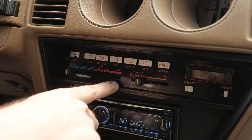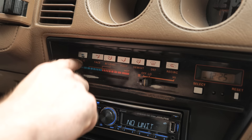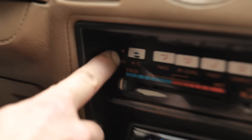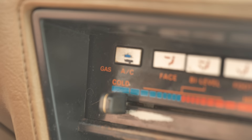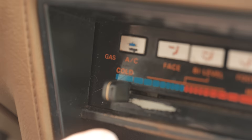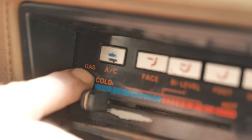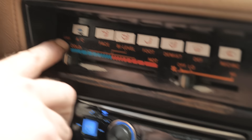My son's car — you'll hear an RPM change with the blower off, then blower on, it's anticipating a load for the AC compressor. Pretty crude system as far as that goes. AC button is right here. Did you see that gas light just come on? It says gas and there's a light that came on. If I shut the car off and restart it, the gas light is no longer on. So it's almost like the system, even in '86, is recognizing that it's low on charge. There'd be no other reason to have a light above an indicator that says 'gas' than the fact that it's low on refrigerant.